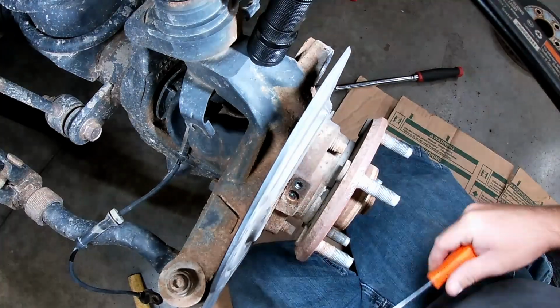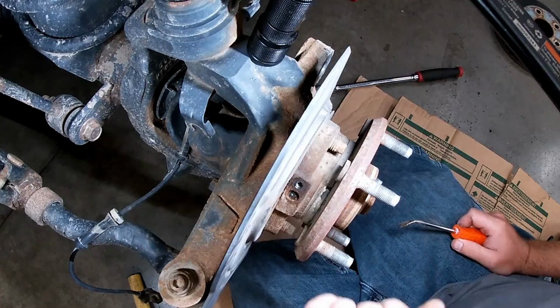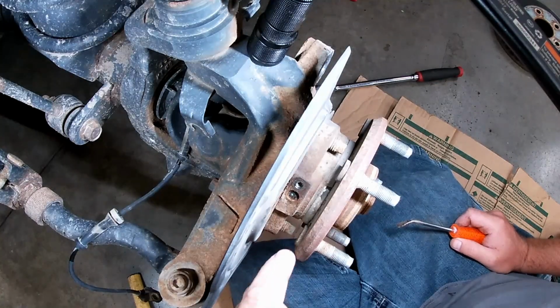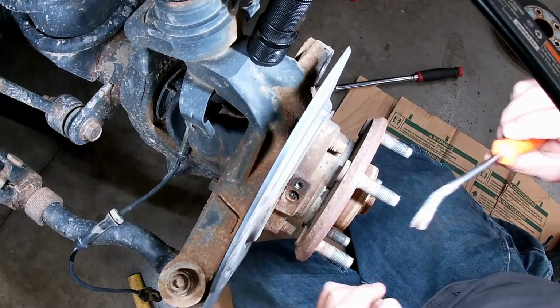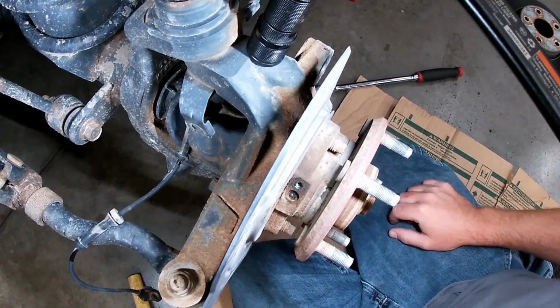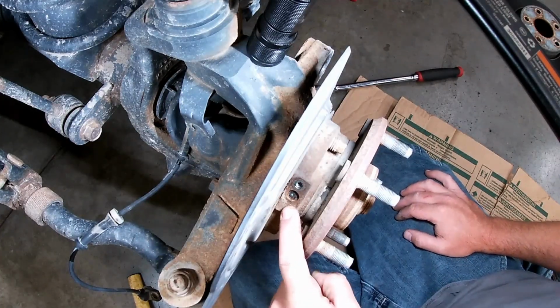So, what I'm going to do is grab a drill and a screw. And we're going to drill a hole, get the screw hot, get the screw into there, and then hopefully pry on the screw and pop it out of there. I'll soak that down in some penetrant too first. And so I'm gonna get a few things and we'll be right back.